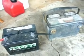It's a 24-volt unit. So what I'm going to do is take these two 12-volt batteries, hook them up in series so I have 24 volts, and put this desulfater — it's called a battery mender — on them and leave it on there for a couple of days, maybe a week, and see if either one of these batteries gets rejuvenated where I can possibly use them in my lawnmower again.